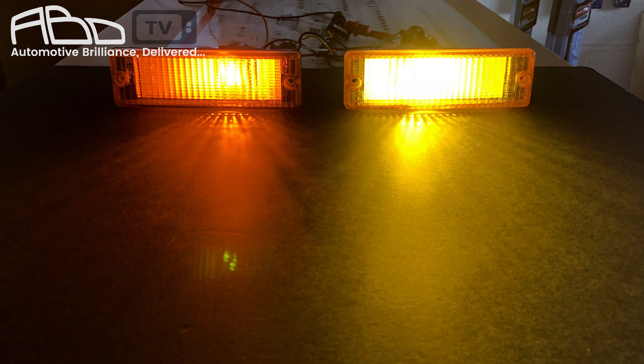One other thing to keep in mind is that during the day, daylight itself is naturally a white light — it's an everything, all-color light — and therefore the whiteness of the indicator from the white LED is actually going to be a bit more difficult to see. So at the end result during daytime, you're probably going to want the contrast of the amber LED coming through that orangey light to give those indicators that true standout color during daytime.